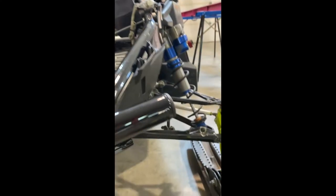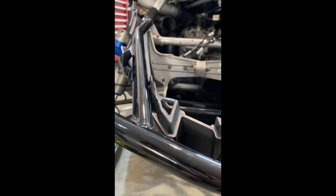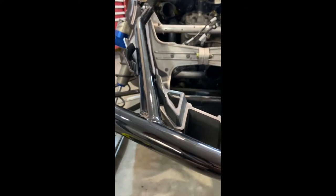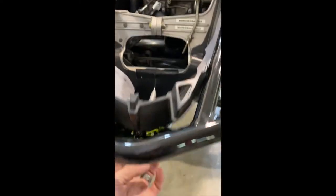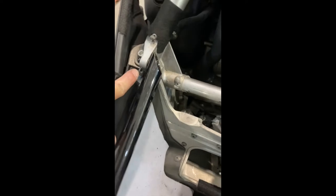This pipe is just a little bit thicker and a different shape than the original bumper, so it wants to push these out. If you just die grind about an eighth of an inch out, then check your hood fitment once your bumper is bolted on, and make sure you've got enough clearance so you don't have any hood interference.